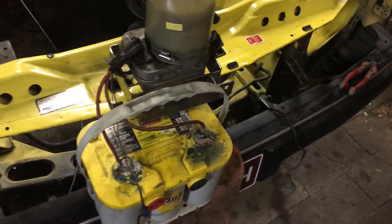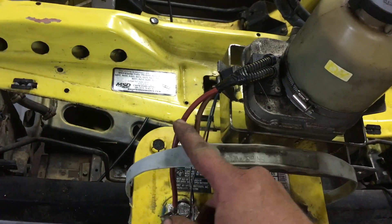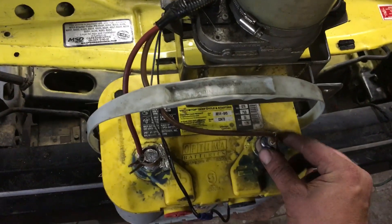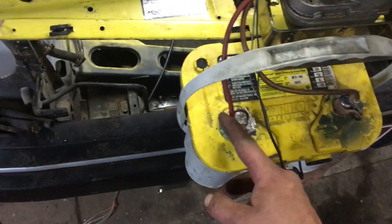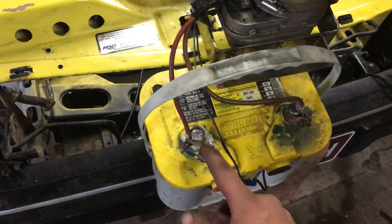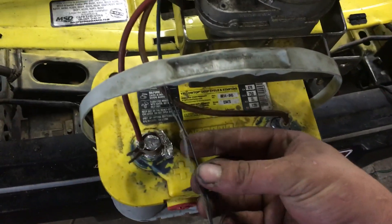When you get your power steering pump you want to look at these wires — you've got a brown one, a red one, a blue one, and a black one. The brown one runs straight to the negative terminal on the battery or straight to earth. The red one runs to straight power, so you want it to have power all the time. I've just wired it to the battery to show you, but the best place is probably straight to the battery terminal.